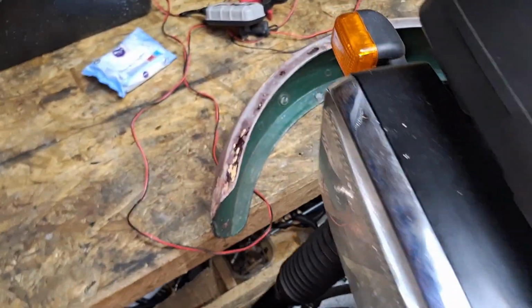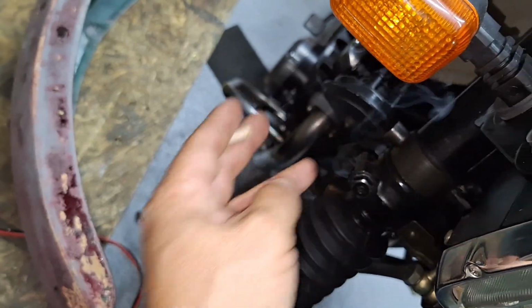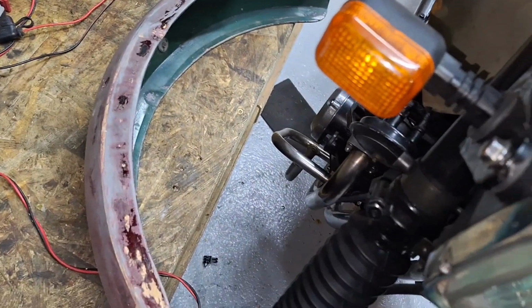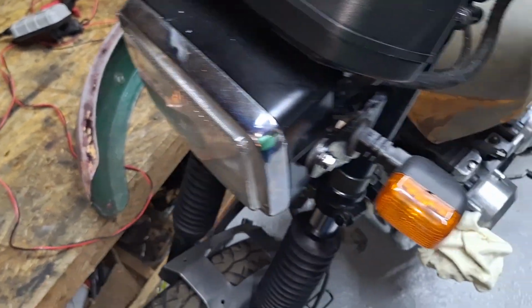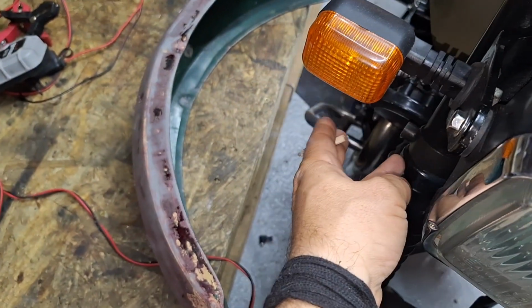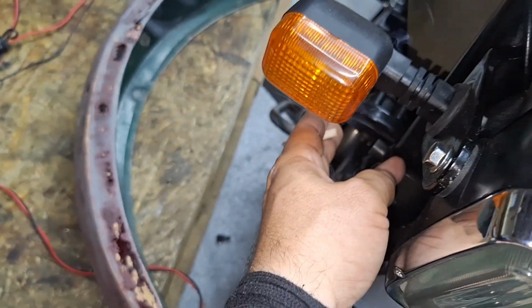First thing that I noticed is that my valve here doesn't work. It's actually letting the air out, and I couldn't put any pressure in it. But the bigger problem is that it leaks the fork oil from these air holes.